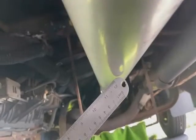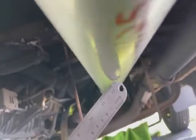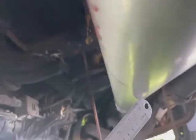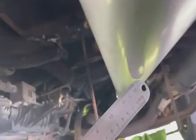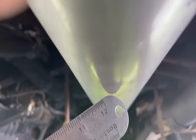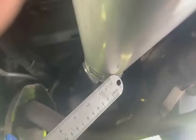I'll spin it — low spot, high spot, low spot, high spot. There's your drag on the low, and there's the high. Same reference point as the rear. Up front, same thing — consistent readings all around.